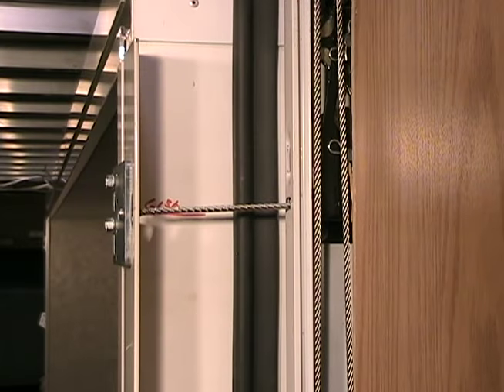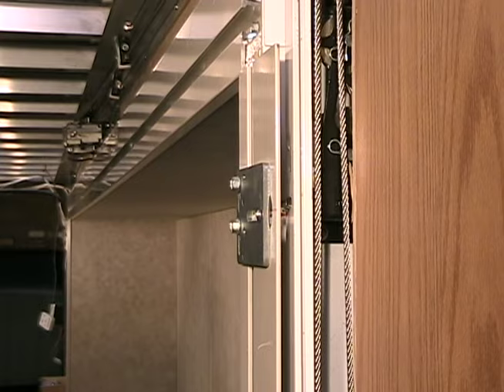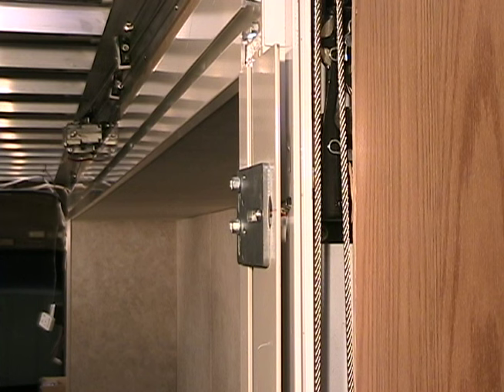This section covers cable replacement with a cable that is frayed but still present. Before getting into the cable replacement process, it's important to emphasize what causes cable failure in the first place. Ninety-nine percent of all cable failures are caused by improperly placed standoff brackets by the installers. This causes the cable to get into a bind, the room may not close fully, and the cable is forced down through the jam rather than going straight through. The cable would be in tension while the coach goes down the road, creating cable failure by fraying one strand at a time. Once you replace the frayed cable, you'll need to relocate that bracket — we'll cover that as we finish the video.